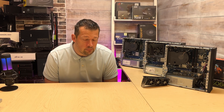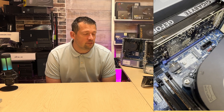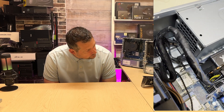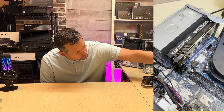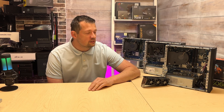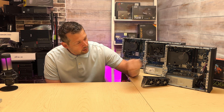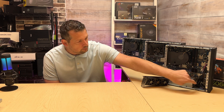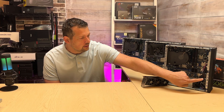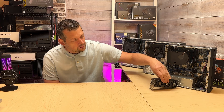Finally I made it work. I was up until 2 a.m. with a soldering iron and a multimeter, figuring out which pin is actually doing what. It's not pretty, but we're doing it. This is version 1. If you are interested and would venture into that, I will probably release a video specifically on how I figured out the pin layout on this power supply and what pin should be connected to where, to avoid frying your brand new card.